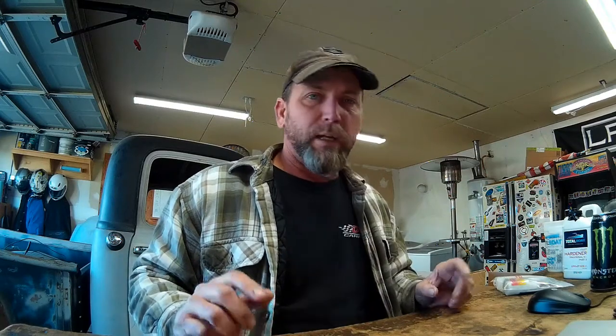I plan to recolor everything in the interior — all of the plastic components. I'm going to order a quart of plastic dye to change the color from gray to tan so it matches my whole new interior color scheme. I'm going to dye the dash and all the plastic components, all the vinyl. The only thing I'm not changing right now is the seat color, because I plan to replace those with different seats that will be tan, possibly leather. I've got my plastic repair kit to fix the cracks, my resins for the fiberglass, and I'm still waiting on the mat for the back side of the door panel to beef up those areas so they don't crack again. I may smooth them completely or re-cover those sections in vinyl.